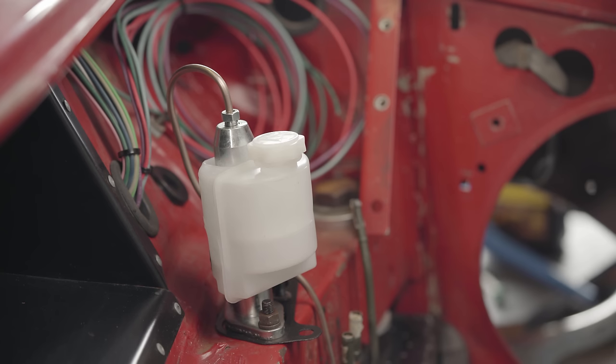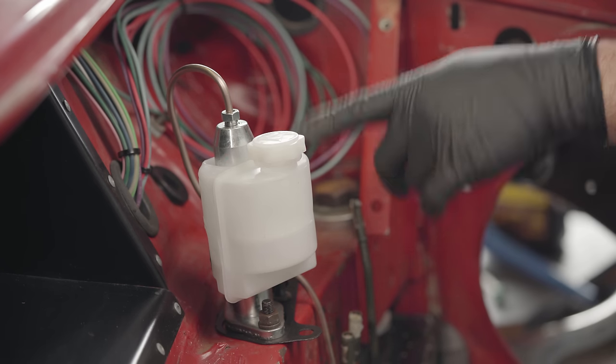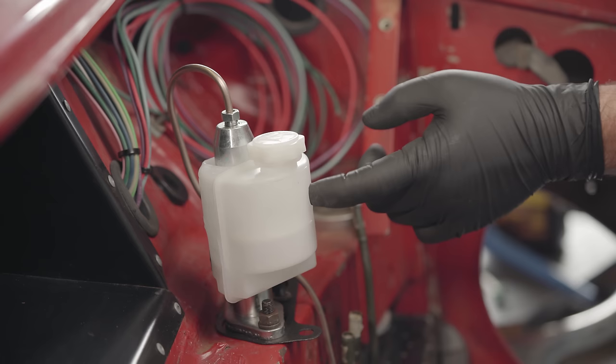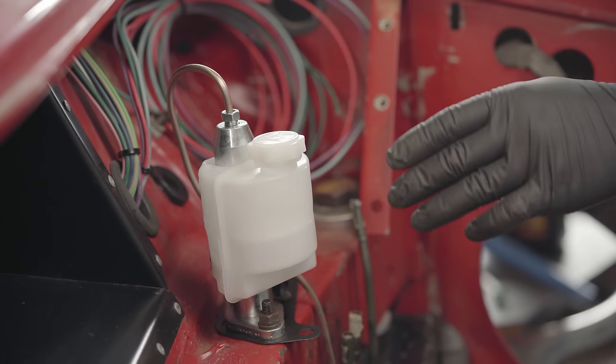When Minis first came out, they had single line master cylinders. These were unboosted setups. This was for all of the early cars, including the drum brake cars and the Cooper S, or some of the Cooper S versions. The single line brake systems, in our opinion, feel the best. They have the least areas for air to go, so they're easier to bleed, and they look more classic.